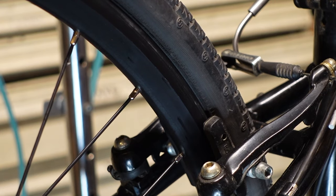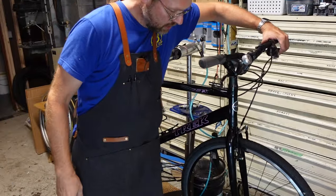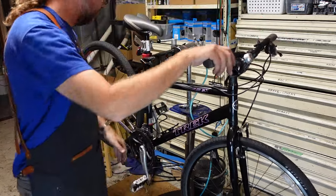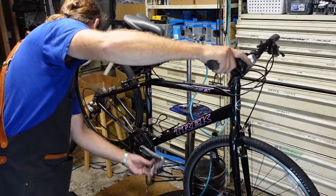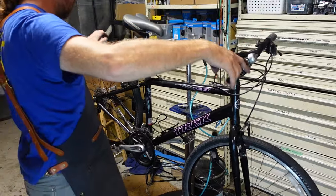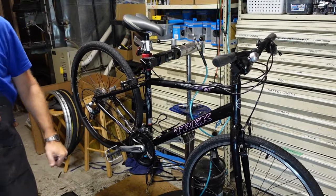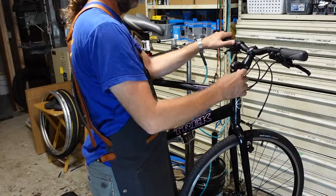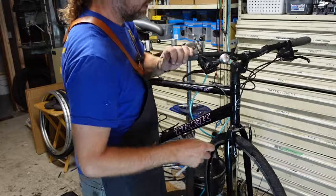All right, this bike is looking pretty good. Just gonna do a couple quick checks. Spin the front wheel, slam on the brake. I'm feeling for a little bit of play in the headset here, and there is none. Go through and run through the gears one more time. Check my brakes, feel the tires. All right, then grab a 5mm wrench, and anything that looks like a 5mm, go through and give it a quick tighten.